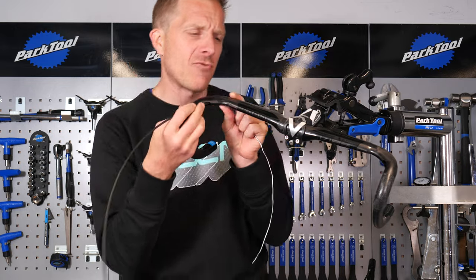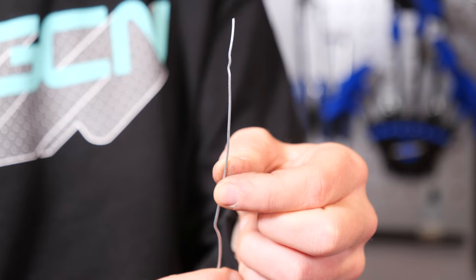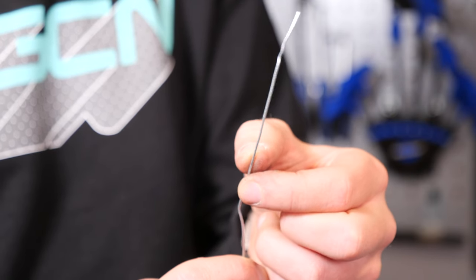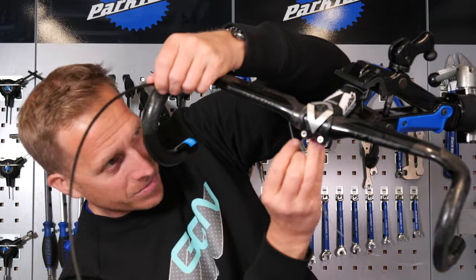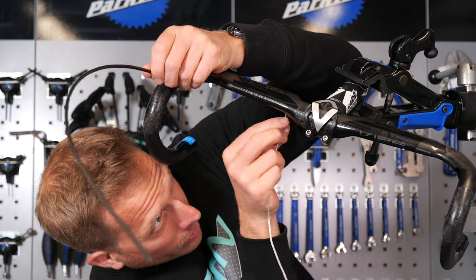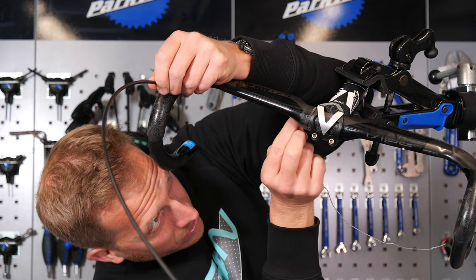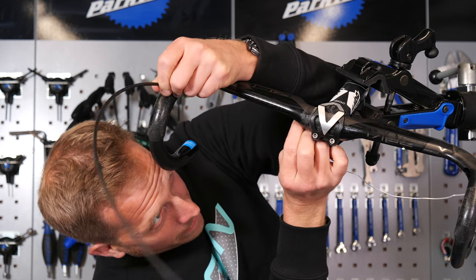What have I got here, you may ask? Well, this is just a bit of really thin garden wire, the sort of thing I hold my sunflowers upright with. I've cut it down a little bit, and hopefully I can match it into the end of that outer cable and try to get it to come out. It does take quite a bit of time sometimes — there's no one solution for all. But once you hook onto it, you're gonna be laughing. The unraveled cable won't do this job because the opening isn't quite big enough to wrap around the outer cable. But with the garden wire, I've got it.